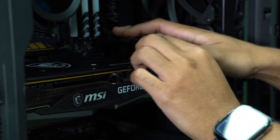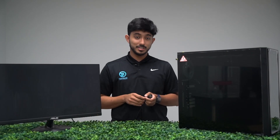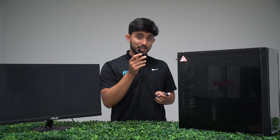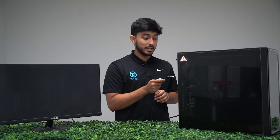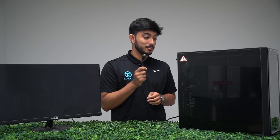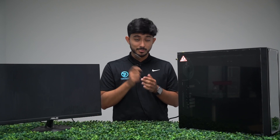Your GPU is ready to be displayed for the clean aesthetic look provided by Paradox Customs and ready for use. Now that we have installed the GPU into our PC, let us now finally turn it on. Take the power supply cable that we provided you with and plug it into the computer. We are using an HDMI cable to plug into our graphics card. Your monitor may differ, so please make sure that you use an HDMI or DisplayPort and plug it into the GPU, not the motherboard.